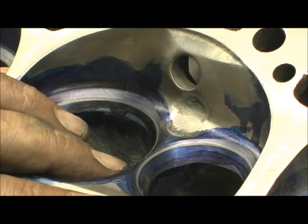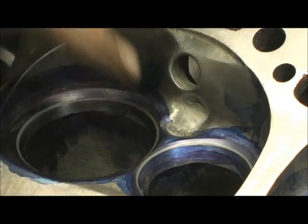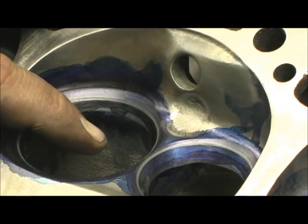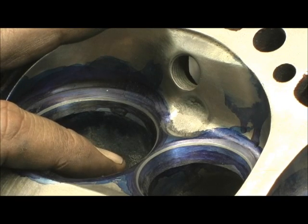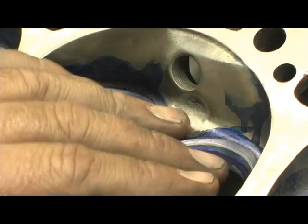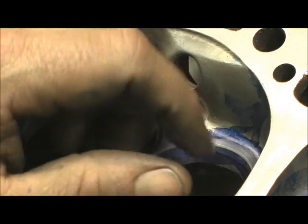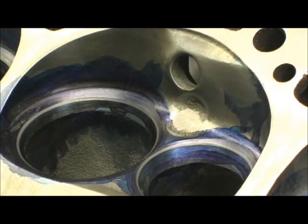Used to, years ago, people thought a valve job only makes a difference at one, two, three hundred lift. Wrong. It can set up the radius to control how much more you got at what lift. A long radius — I'm not going to say what it means, some of the things I'm keeping to myself. A big long 70 might mean a better turn at low lift, whereas a short radius might be a better high lift flow. So you try to use that knowledge to compromise.